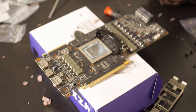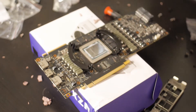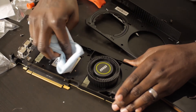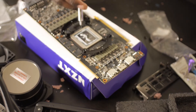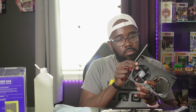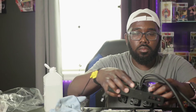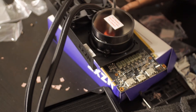Then you attach the bracket. I had to use the AMD bracket — I looked it up ahead of time, but it seems like a lot of the 20-series cards don't work with the included Nvidia bracket since this kit has been around since the 10-series. The AMD bracket works properly, so you have to use that. Then you put thermal paste on — apparently you have to put a lot on for GPUs. I ended up not putting enough and had to redo it off camera. After that you attach the fan with the cooler, then attach the AIO. I removed the pre-applied thermal paste with alcohol, then screwed the cooler into the fan, and that's pretty much it.